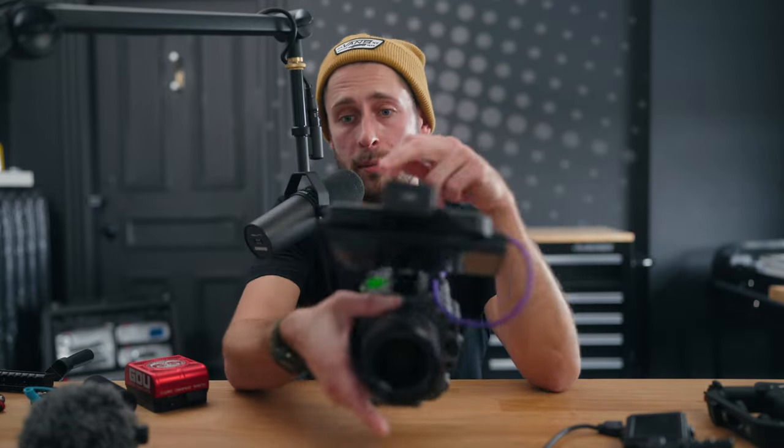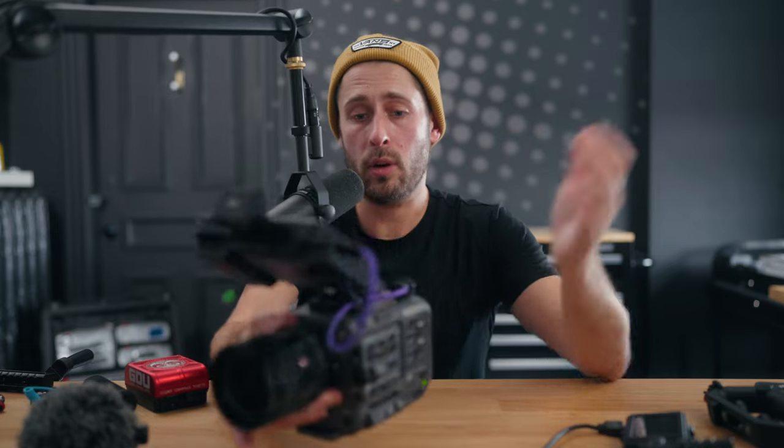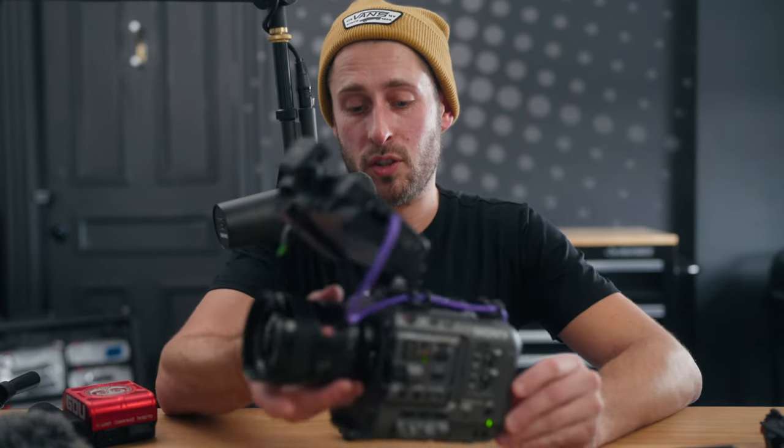I don't need to show you anything else. If you want to record video from your FX6 without the top handle, all you need is a Ninja V, the hard drive, HDMI cable, 3.5mm cable, and whatever powered 3.5mm input you want to use. That is all I've got for you in today's video. Hopefully this gives you some creative ideas — if you've been looking for a solution like this, you're welcome. I'll see you in the next one. Take care.